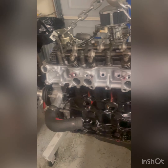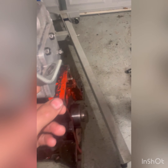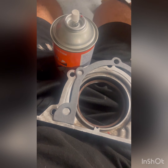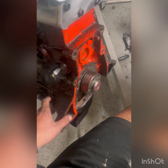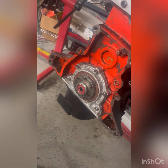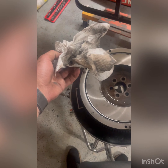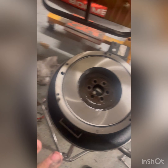I went ahead and put the intake manifold on - looks really good, just a few bolts and a couple of nuts. I put it up on the engine hoist with a new rig because when we took it out the engine hoist couldn't lift it high enough and it was hitting my truck - now I have everything lifted up a lot more. I'm putting this thing onto the back of the block, then I'm going to go ahead and paint everything, and I'll have to go pick up my flywheel from the machine shop along with some spark plugs and the engine will be ready to throw on the car. The flywheel is acquired - you're going to want to clean it off with some brake clean, look how much I just got off of this thing. Make sure you clean your flywheel before you put it on, whether it's brand new or just got machined.